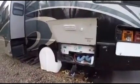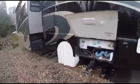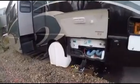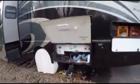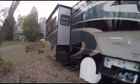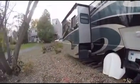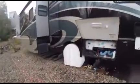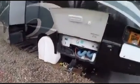But now, the way that we do it now, we've always just done the air flushing. So we air flush it, and then we put the antifreeze in the traps, and that's pretty much it. That is another accepted method of winterization. So hopefully this helps you, even if you don't have a Winnebago like ours. The systems are very similar in a lot of RVs, and there's not a whole lot to it. Really about 5 or 10 minutes work and you can have it winterized. All right, thanks.